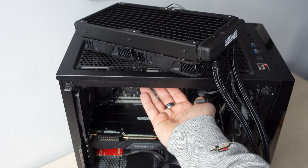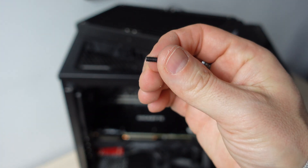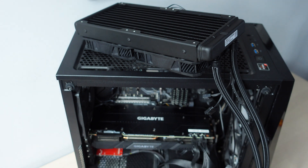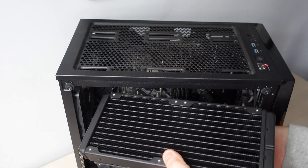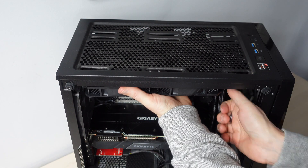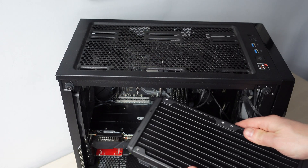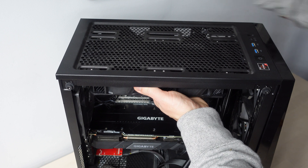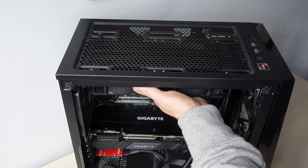Now it's time to get this mounted under here — that should be fun. You use these smaller screws with the washers and they go down into your case with the radiator on the other side. What I'm going to do first is thread the cables through the back just so they're out of the way, because it's easier to do it now than when the radiator's in position. There are some I/O cables here and the CPU power connector's fouling, so I need to pull that through a little bit. Now it's a case of screwing it in — I'm going to work from corner to corner, just hand tighten them to start with.